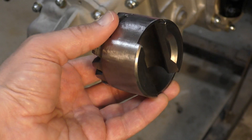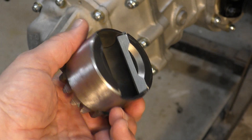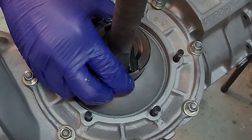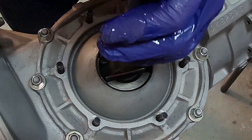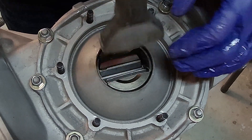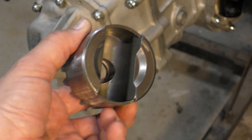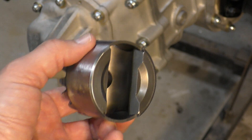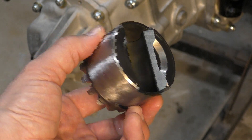This is an aftermarket side gear I bought off the internet to replace my right gear, and it turns out it's also bad — it won't fit into the transaxle at all; it's completely useless. This might work with a Brazilian or Mexican transaxle, but it won't work on a German transaxle. If you have a problem with your side gears, find good used original German side gears — don't bother with aftermarket.